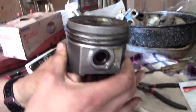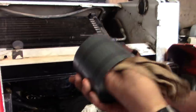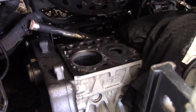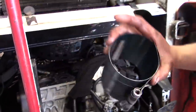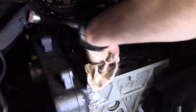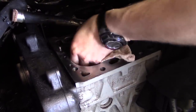We're going to put the piston in. I've cleaned out that cylinder and removed all the carbon that was up on top — pretty much cleaned it out with carb cleaner. Just put some oil on my rag. I like these rags because they don't leave linties everywhere. I'm just slightly oiling my ring compressor and lightly oiling the cylinder all the way down to the bottom, so that way the rings aren't metal on metal. Then we put it in.